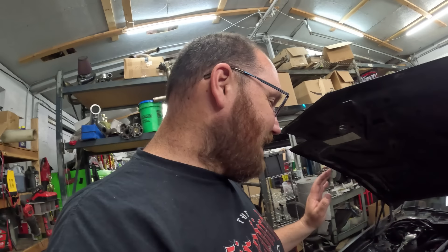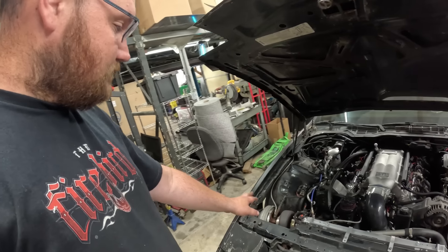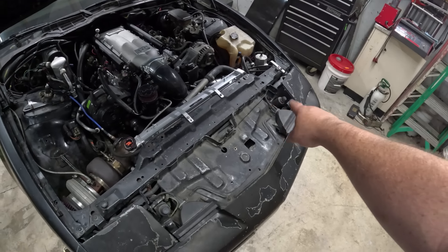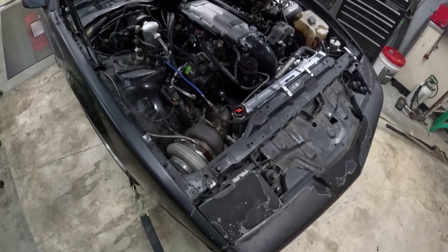I forgot I had to purchase the traction control strategy again to do that, so I just haven't done it. I really don't want to put the lightweight one in here because it kind of seems like a waste — I really think I'll feel two pounds in the race car. Every time I have to use the porta potty before I make a really fast pass it always comes out good, so I figured two pounds with a Dominator just gets me a round or two ahead. I do have a little turbo on this one — it's only got a VSR 8896 with a V-band 1.30 A/R exhaust housing. We have a water-air intercooler hiding underneath this headlight here, and an air filter on my turbo which has seen some water because I drive it quite a bit. We just took the Cold Case radiator out of it for a Mishimoto because the Cold Case expanded like a hot air balloon without even hurting a head gasket.